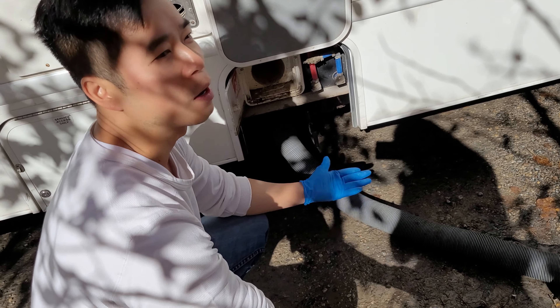Now it's about dripping away. I'll let it drizzle for a bit more because I want to get it as empty as possible. Now lastly, what you want to do is called walking the hose — take the hose from the top, lift it like this, and get the rest of the gunk out. Walking the hose. Now it's going out of the sewer area. You could do an additional wash — I'll show you how to do it.